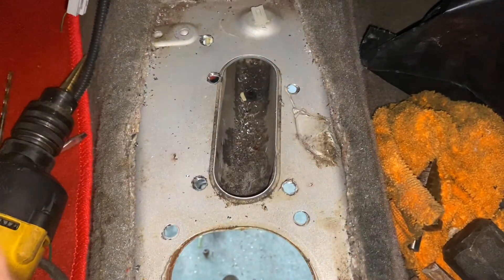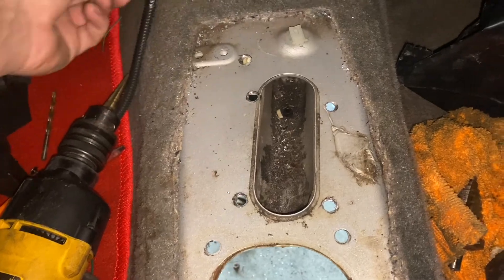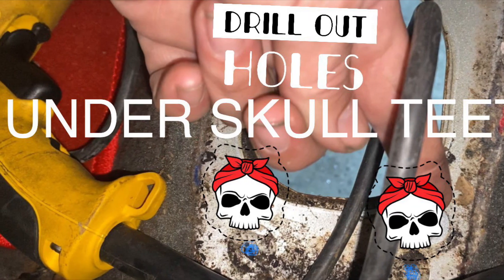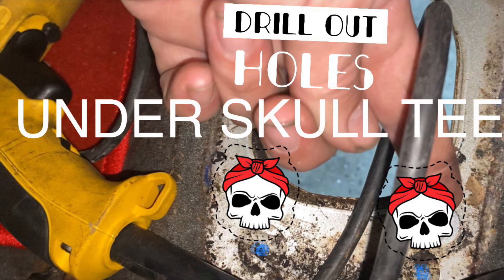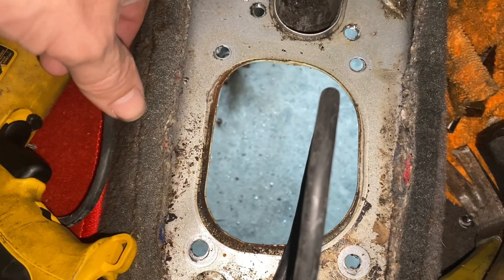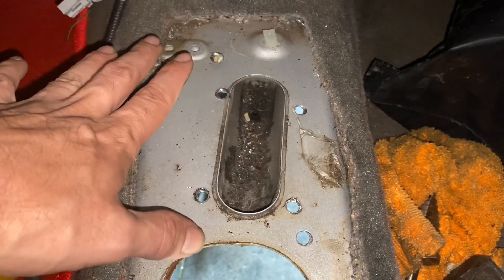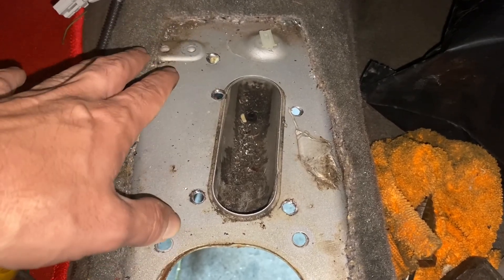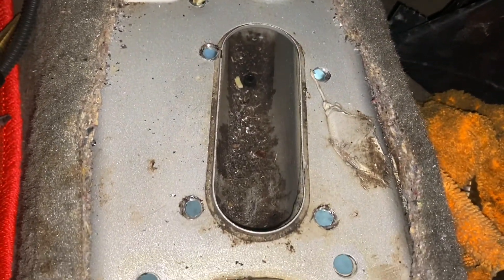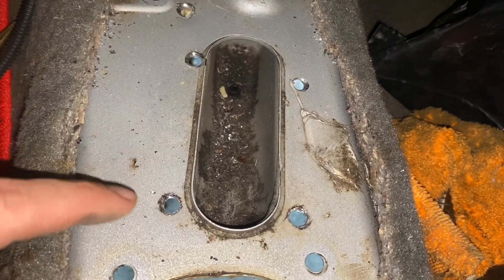On this automatic setup, you've got four bolts on the bottom for the shifter. Once you modify that plug like I showed y'all, the other two plugs can be pushed back out of the way. Make sure the shifter will bolt into where it goes right there. With the rubber bushing — this is where we're drilling out. I can see one, two, three, four, five — I'm going to drill these out pretty big, then go to the bottom side and see what's left.